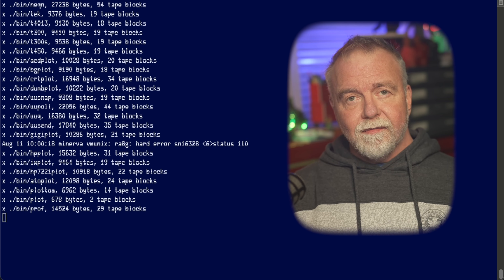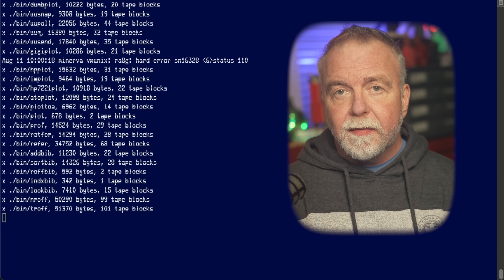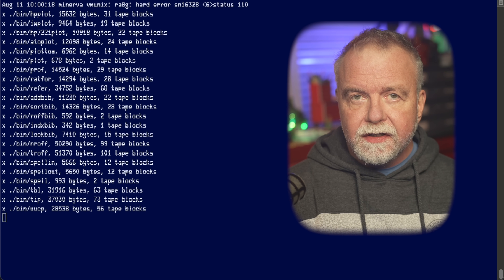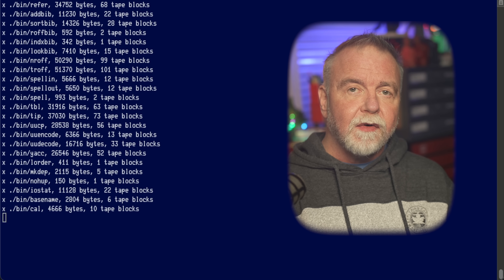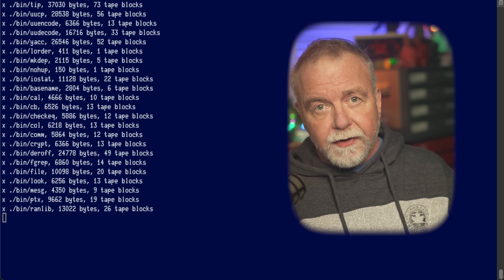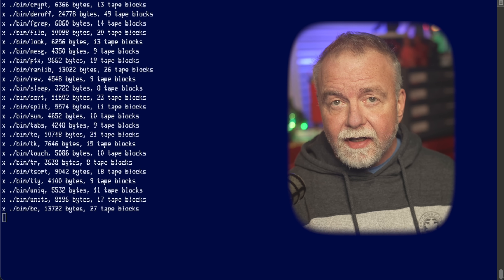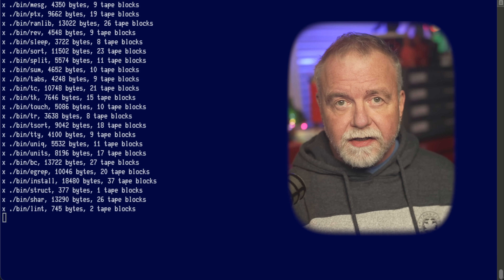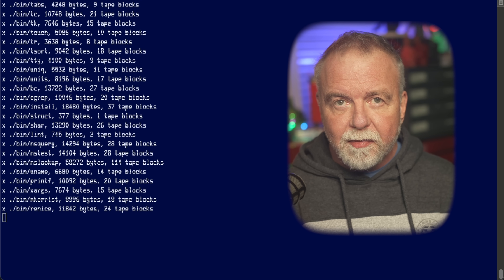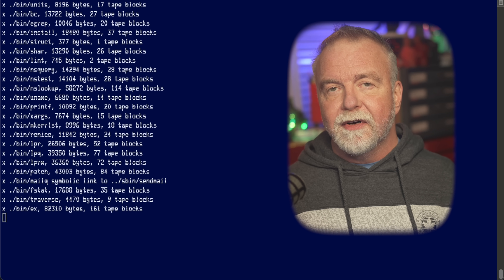Second, they gave the drive a brain. The dual CPU architecture - a master for comms and overall control, and a servant for servo and mechanics - lets the unit own its behavior. Power-up diagnostics, lab tests, fault isolation: all present and accounted for on the drive, by the drive, without CPU overhead. And third, they isolated you from the physics. MSCP on the PDP-11/73 is a civilized interface. You just ask for blocks, and the controller and the drive conspire to make it happen. You never have to think about skew, detents, RPM, heads, sectors, or tracks - other than when you're doing a disk label or what the servo is complaining about that day.